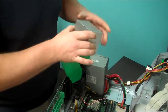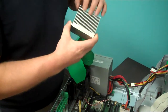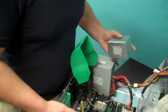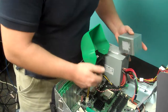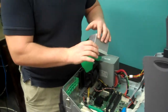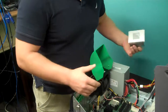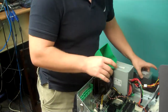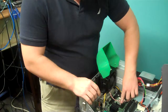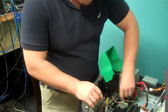This one's made of aluminum, and all it really does is take that heat and distribute it up these tines. As these tines heat, your fan will spin and basically create wind and blow over the hot tines to cool them. So that heat's coming up and then it gets dispersed by the fan. And that's the primary way you'll see that a processor is kept cool, with just thermal compound, a heatsink, and then a fan directly blowing on it.